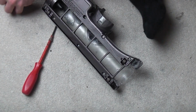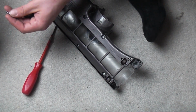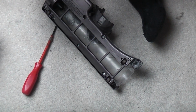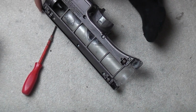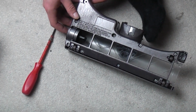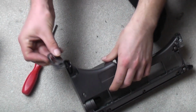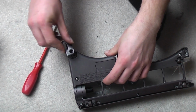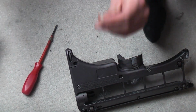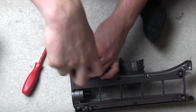Now for the little wheel that sits in the back corner. Again, just paint the smallest drop of lubricant. Doesn't need to be much. All you're doing is to stop it squeaking or sounding dry. And then you sit the wheel in first and then simply drop the housing on. Like so. Then get the one and only crosshead screw in the entire machine and fit it.